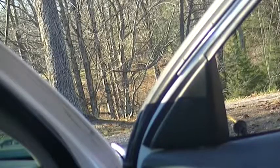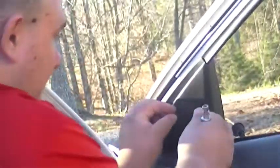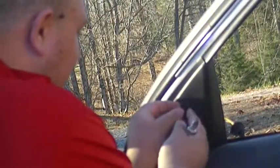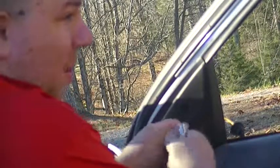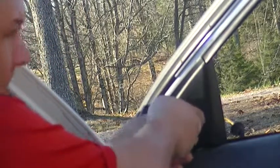This video was about how to replace the side view mirror on a 2001 Ford Taurus. First, you remove the center cap on the black part next to the window. You can use your fingernails or a screwdriver. Then you need a socket and a ratchet, obviously.